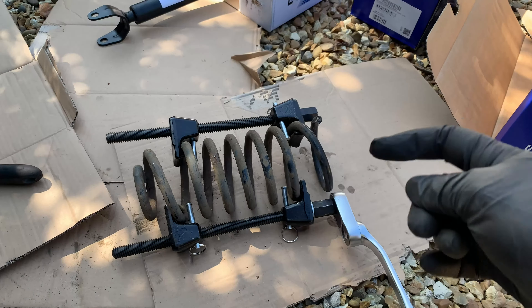I've got to compress this down a little bit to get the rubber and dust cover out. There was a lot of energy stored in this spring which is why I use these clamps, but a slippery one is dodgy. What I found is when you're putting compression on, you want it to be even - don't overdo one side because if you do, the other gets a bit loose and it can fly over and you have to start all over again. Count your turns: do a quarter turn, count ten on each side, then ten more, alternating evenly. If you just undo one side it'll banana on you.